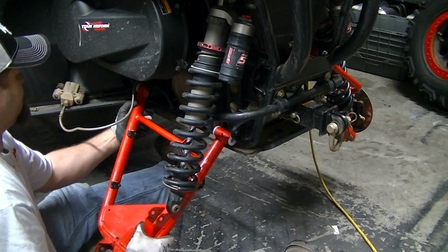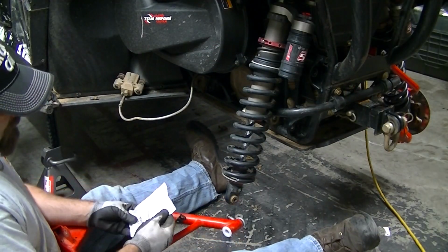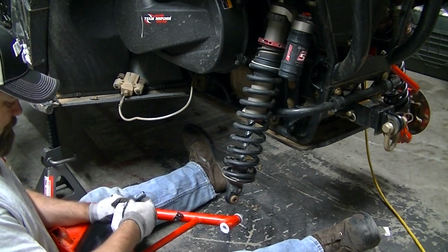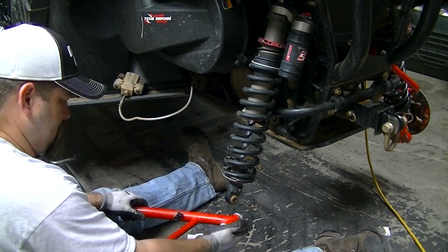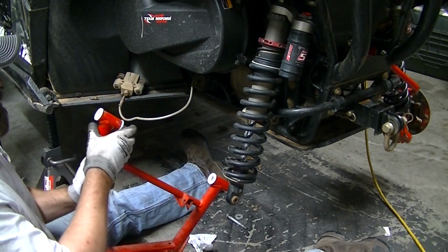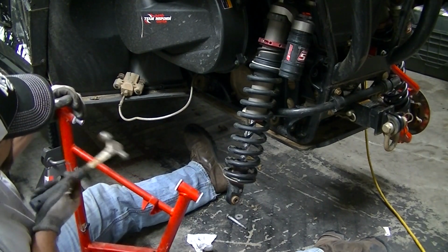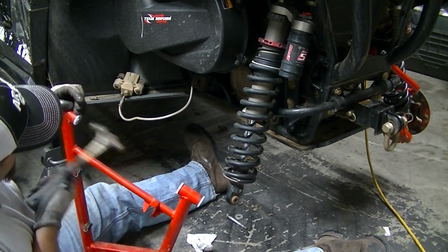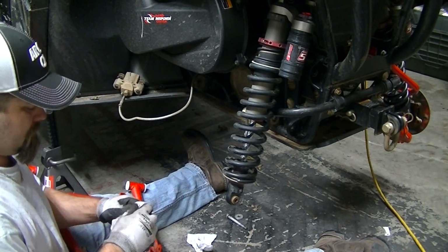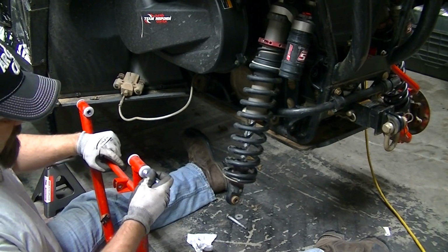Yeah, sleeves would help. So in the lower A-arm, you're going to put 2 sleeves in there, and they're just labeled sleeve suspension. It's a 0403-250. And we'll put one in the other end. Same part number sleeve.